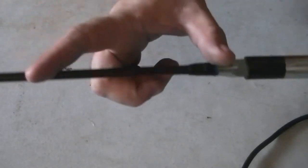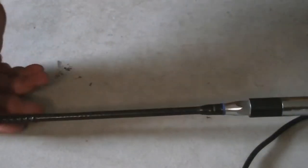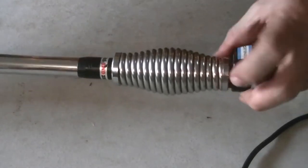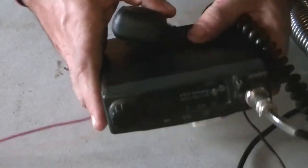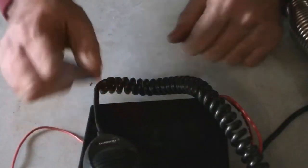We're going to be doing this next week — I'm in Bendigo next week so we'll be doing it then. I'm hoping my little whip antenna, which is the short one, fits this mount — in theory it should, but I'm not sure. This is the full length one and it's a lot more solid. You can see there the inductor coil is much longer than my original one. It is a proper GME aerial — not one of the cheap nasty ones. It's got a good strong spring, especially handy if you're out in the bush. It fits in my original mount, which is even better.